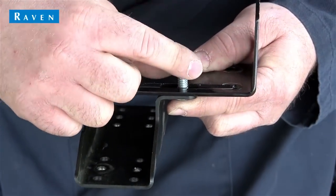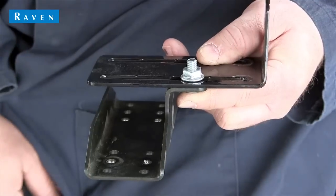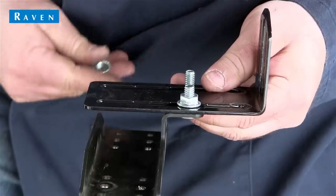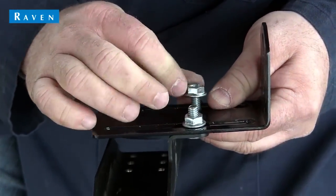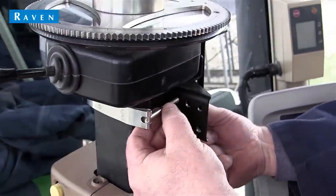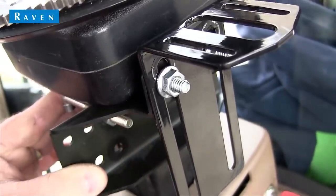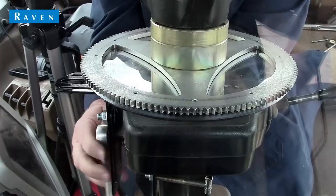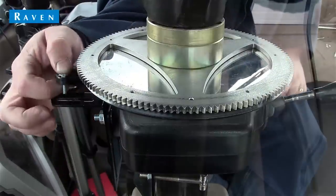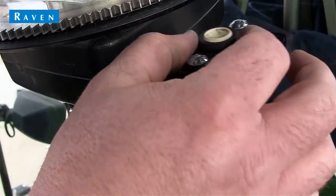With the ring gear and steering wheel in place, it's time to install the anti-rotation bracket. This bracket keeps the MDU anchored so that it can turn the wheel. Start by assembling the U and L bracket as shown here. Just be sure to only finger tighten the nuts as they may need to be adjusted during the installation. Next, we'll attach the strap clamps around the steering column and to the anti-rotation bracket. This will hold the bracket firmly in place around the steering column. After both strap clamps are installed, you can tighten up all of the hardware on the bracket. And for our final piece of the bracket, we'll install the flange bearing. This mounts off to the side and will hold the anti-rotation pin attached to the MDU. The flange should be able to move freely.